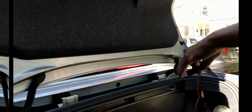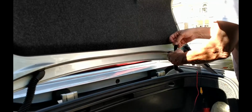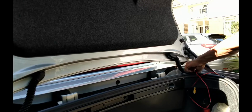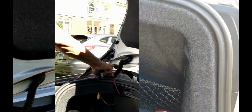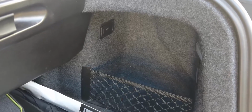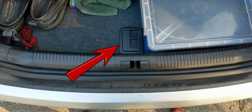We connected the first and second segments, and since the connector will end up permanently hiding in the tube, we taped the connection together. In the end, we taped together all our connections. We then pushed the remaining wiring into the body and reconnected the tube ends to the body and the trunk. Now the tedious part. We need to get behind the trim in the trunk on the right side. To do that, everything needs to come out of the trunk.